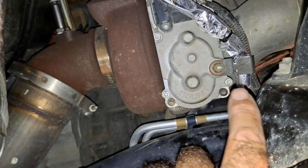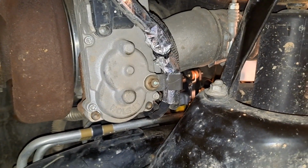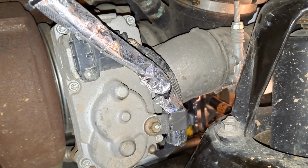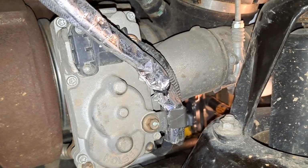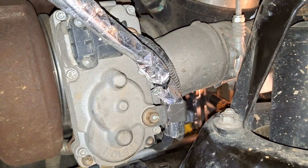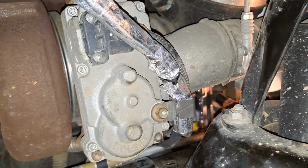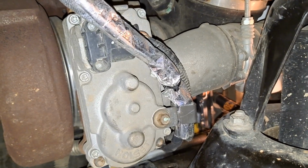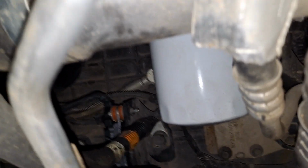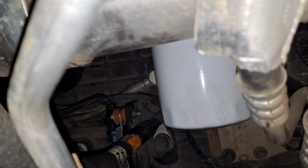This is a factory clip where it goes to, and the real problem is where that connector bracket mounts. I'm going to try to get a close-up shot of that, but that's where you need your extra set of hands. There are two little screws with some insulating vibration mounts. You've got to put all that together through the bracket, and then there's a little nut on the back side that you attach it with. Let me see if I can get a closer shot. So here's the top side of that bracket. You can see the little orange vibration insulative mounts.